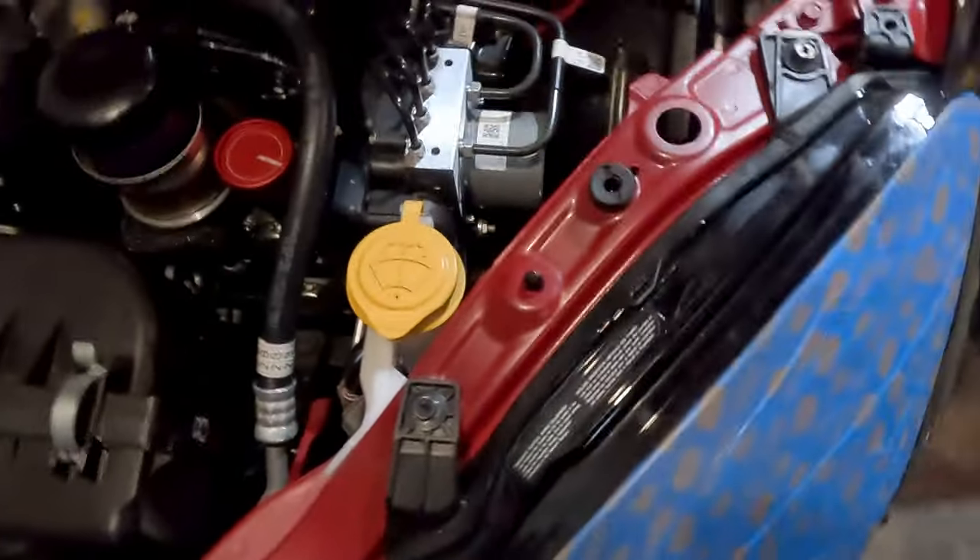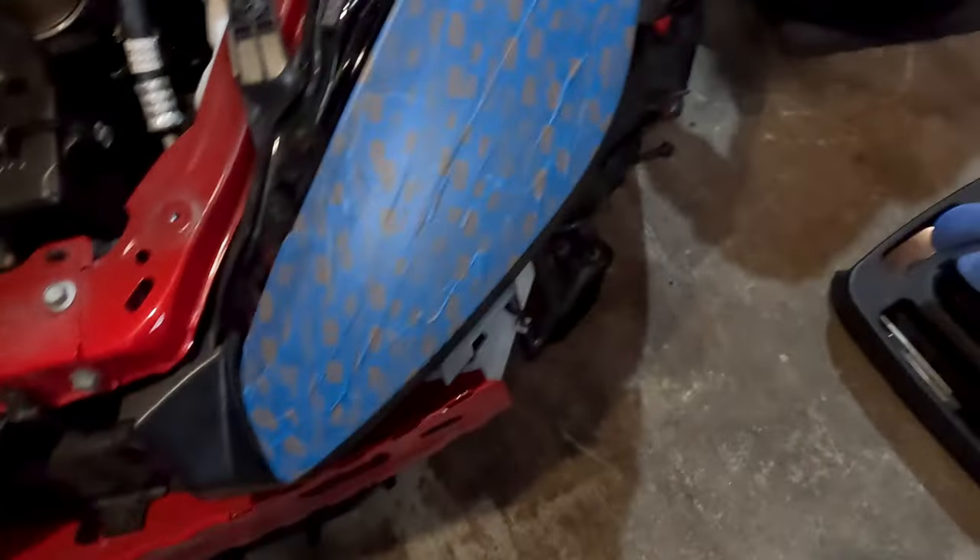I'm using a little cutout in the bumper. You do have to pull the bumper to be able to pull the headlights, because you have to do the actual bumper cover mount. These three little clips in here is what the bumper clips into.